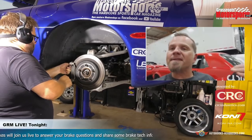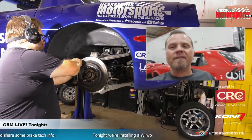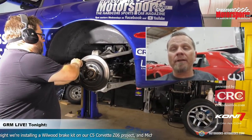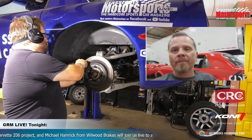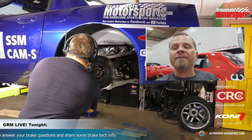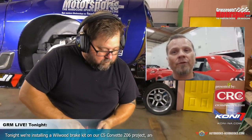It's really good at high temperature. It's not going to be great on the street, but it's going to work at a good high temperature. Usually, you'll start to see this pad start to come in somewhere between 400 and 500 degrees, but it'll exceed over 1200 degrees, no problem. So on a road course, it'll be fine. Knowing what type of driver, that's where I really try to work with guys who are maybe starting off as a novice, then turning intermediate. Now you're talking about getting them into a different brake pad, and then going from intermediate to more of a pro, you know you've got to step up your game and get the right formulated brake pad for what they're going to be doing with the car. And it's going to have to suit them.